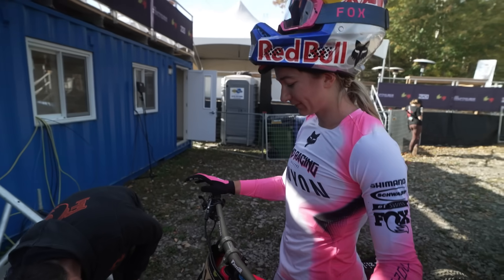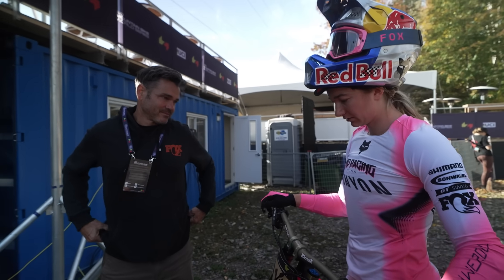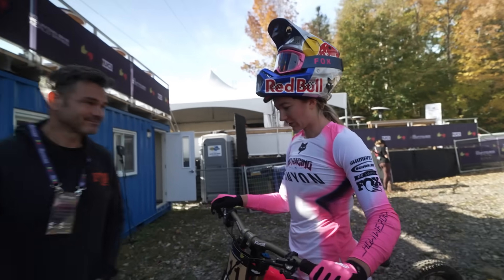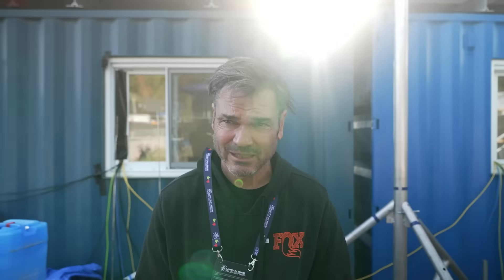It's nearly there - good, yeah, thank you. We dropped pressure, then sped rebound up to match what we were going to do, then she slowed rebound back down, and now we've sped it back up. Kind of not a shot in the dark, but I think that's the last run before qualis. We'll see - that's pretty good.